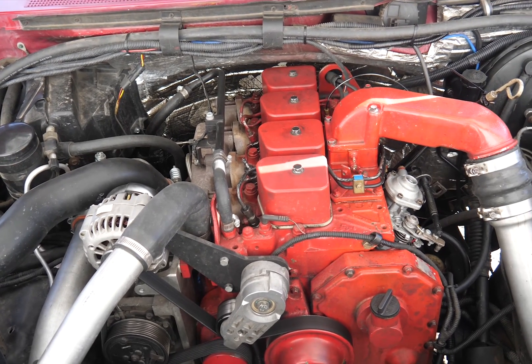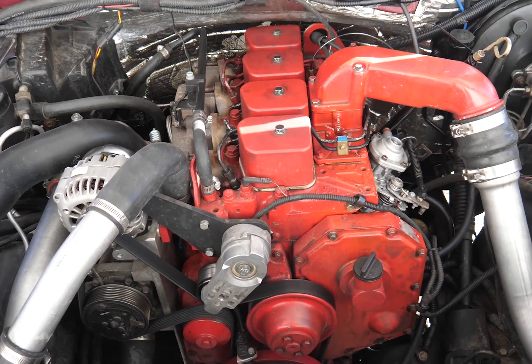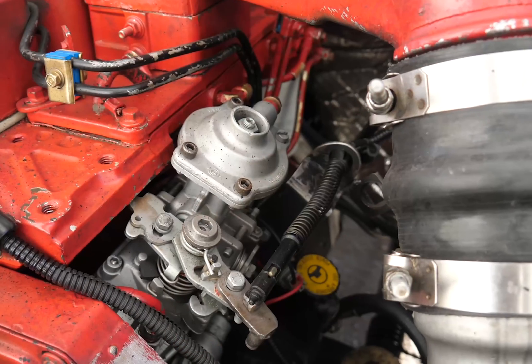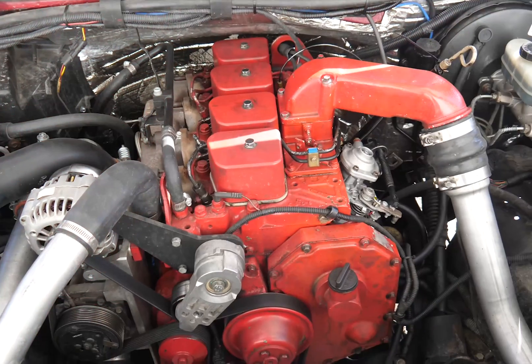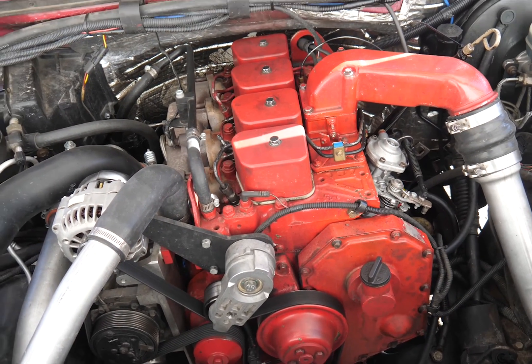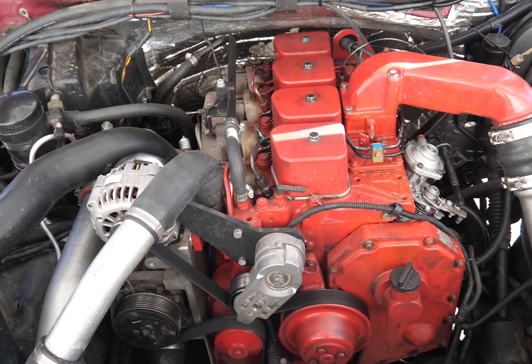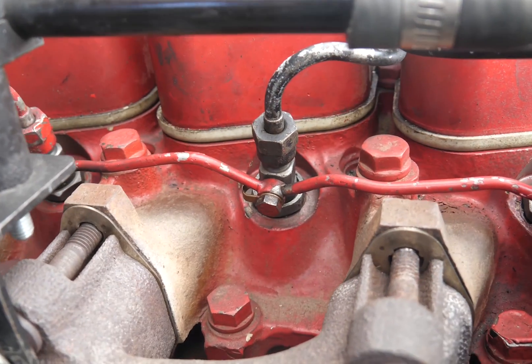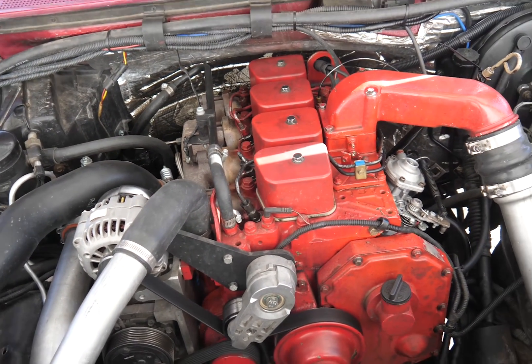The package was really basic. The injector pump was sent out, had some work done, and it just has a governor spring and a fuel pin — it's moving about as much fuel as a rotary will move. That fuel is then going through a set of 7x9 injectors.